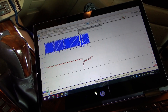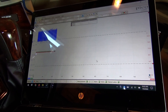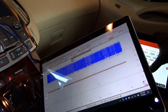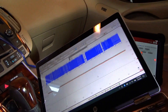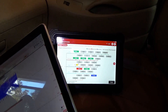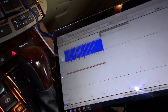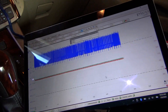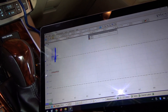Starting up to recreate the fault — will that 12-volt signal drop out? Traction light is on; resetting and clearing all the codes. One code still remains after clearing: 'control communication bus off.' Let's look at the network.